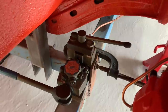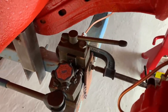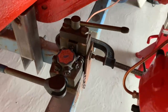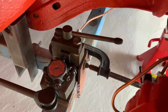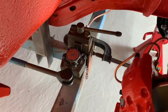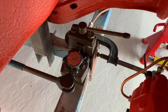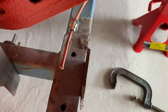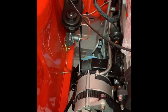I'm being very tight here. Rather than going out and buying a handheld flaring tool, I've clamped the vice-mounted one to a bracket already welded on the frame and brought the pipe down to it to put the flare on — just to save a bit of money. To be honest I could do with a handheld flaring tool but it's not top of my priority list. And don't knock it — it's just done that job absolutely perfectly. We're done, bolted in, the pipes are connected up and tightened. The brakes are well on the way. We need flexi hoses for the front to go from the bulkhead to the struts, and the brake assemblies together on the axle, and that'll be the brakes ready to bleed.